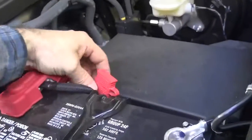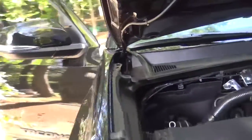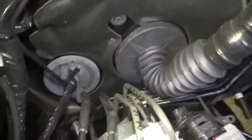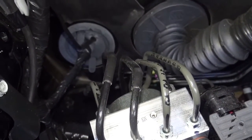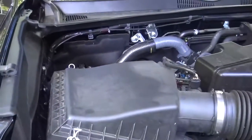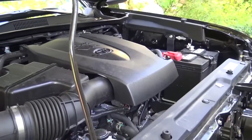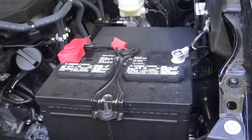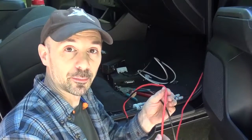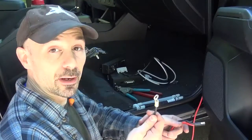The installation's done. Fuse holder is here. The wire is going to be running right up against the wire loom and right down into the ground. Very simple installation — we have about 45 minutes into this install. That's the easiest way to run a wire out of the firewall. The best place to connect a two-way radio is directly to the battery, due to the filtering capabilities of the battery. Cigarette lighter plugs and internal things tend to be a very noisy source, especially on a high-powered transmitter. So we only run a single wire out to the battery, and the grounding is done inside. Since this was previously installed in a vehicle, it has a grounding lug loop on it already.